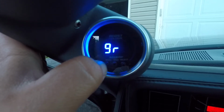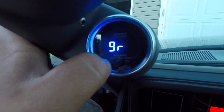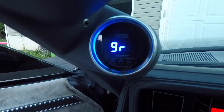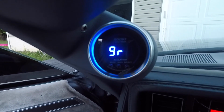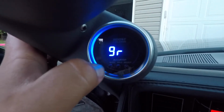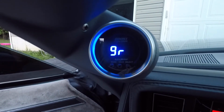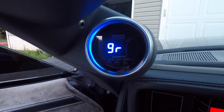The PCA, I don't remember what that was, but if I don't remember it, I'm not using it. This is the gear. It helps you save each gear that you need to use with the boost by gear. You normally drive in first gear, hit the record button, and you do that with every gear, and that gets you the value that the gauge needs to run in real time. So in other words, there's no switches to reset or anything. If the car is in first gear, the gauge knows the car's in first gear, and so on and so forth.